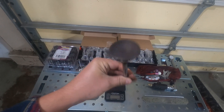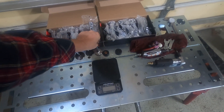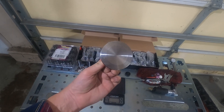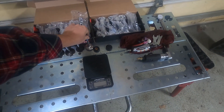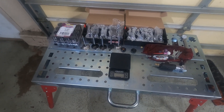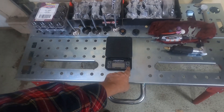That one certainly feels the heaviest. Then on the exhaust side, they didn't remember what those were — there's no undercut on them, nothing. Our new ones again have a nice undercut on them, a little bit of a dish, and they certainly feel lighter. So to confirm that, I went and stole my wife's coffee scale. Hopefully she won't watch this video, but we're going to see just how much lighter everything is.